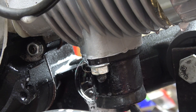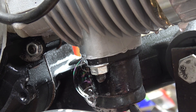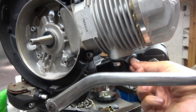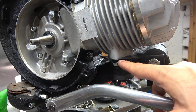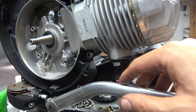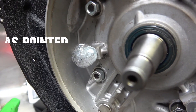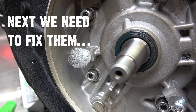The issue is how poor the seal is on the exhaust flange gasket — this is why it's better to test with a bung in the bottom of the exhaust flange rather than just putting a rubber gasket underneath it like a lot of people do. The exhaust flange is so badly made, so little gasket area, and it was not very flat — I'm going to have to linish it to get it flat. With a complete rubber sheet underneath acting as a gasket, the gauge is going down very slowly up from 40, and why is it going down slowly? Because there's a leak through the screw hole. That explains all the issues — the rest of the motor seems to be okay.